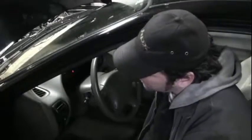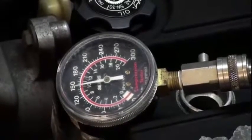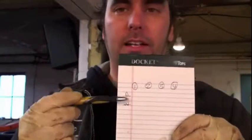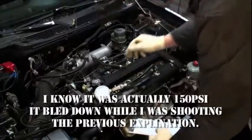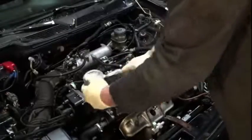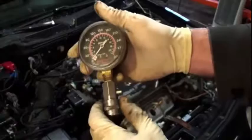You or a buddy needs to be inside the car to crank the engine. Do a five count — you'll hear the engine turning over, and I usually count to five every time I hear a little gallop or skip: one, two, three, four, five. Now here's where the academic part comes in — get yourself a notepad. I have four cylinders here; write down a number for each corresponding cylinder. I put a D and a W — D for the dry test, W for the wet test. Cylinder number one reads about 120.